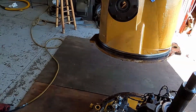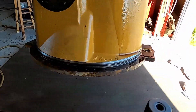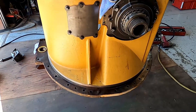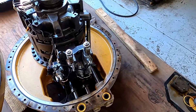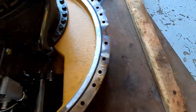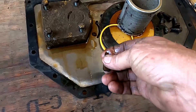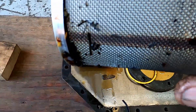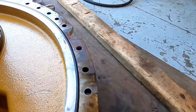It seems kind of funny — this big huge unit and there's the transmission, this cute little tiny thing inside here. But most of that is the differential unit and the power transfer unit to go to the tracks. When this is in the machine, these connect the shafts that go through to the final drives for the tracks. I'll set this on a pallet to get it out of the way with the forklift, then we'll remove the valves and pull this planetary section apart to see what failed. I did find a little bit of steel inside when I was pulling the screens off the bottom — it looks like part of a plate. There was also what might be a lost zip tie, plus stuff on the screens that almost looks like adhesive or seal material.